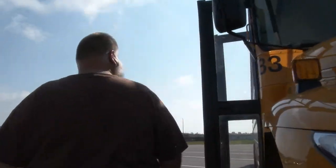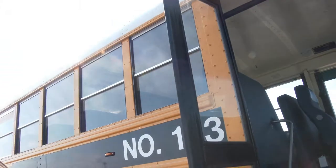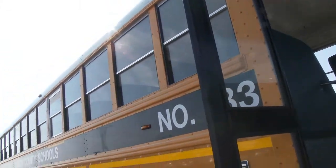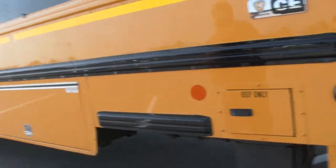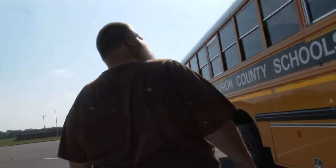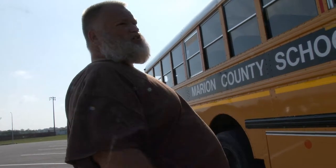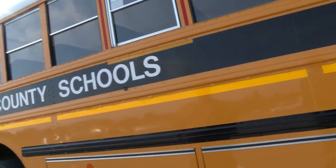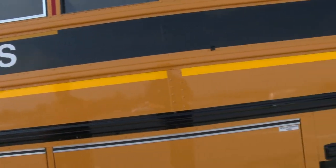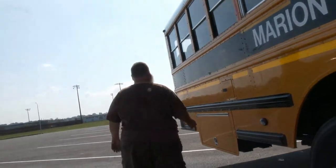Making my way down the side of the bus: I have an inside stairwell light, securely mounted, not cracked or missing, and working. Running lights down the side are securely mounted and working. Outside step lights are securely mounted and working. All windows are securely mounted, not cracked or missing. Emergency windows with reflective decal tape for emergency service personnel are all securely mounted. Reflective decals and three reflective triangles on the side are all securely mounted, not cracked or missing.